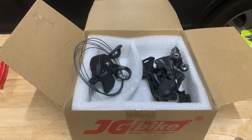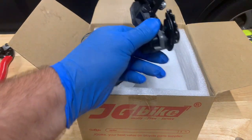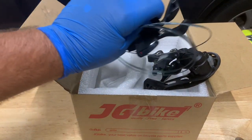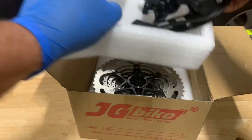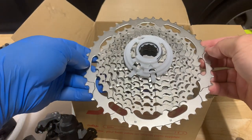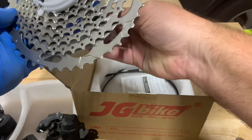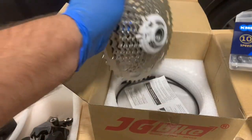This is what I'm going to be switching it out to. It's a kit that comes from JG Bikes, bought off Amazon. It is a Deore M4120 rear derailleur, M4100 10-speed shifter — no numbers on it. It comes with a cable pre-attached and also ships with an 11 to 46T 10-speed cassette, a KMC 10-speed chain, and new cable housing which I probably won't have to use but we'll see.